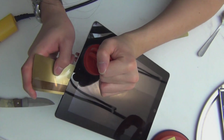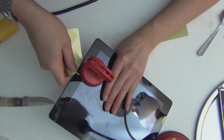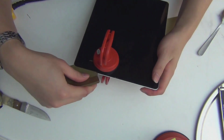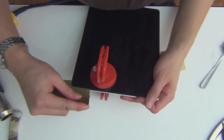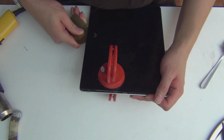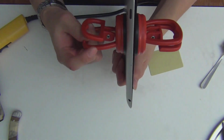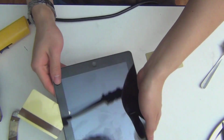So I could do that. Try it a little bit open and work your credit card skills. And there we go. A little closer. And use a pick if you have to. Once you heat up the glass, the adhesive comes out relatively easy. So I'm all the way down. Now I have to do the same thing again down here.